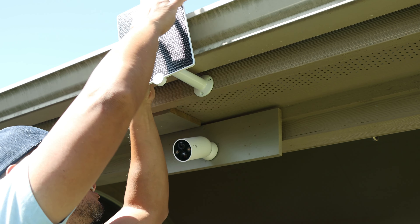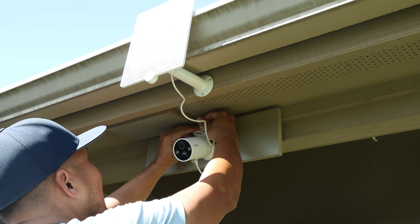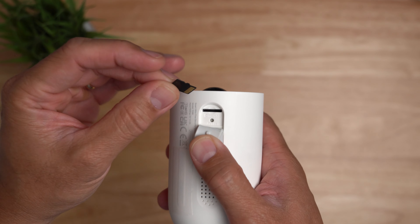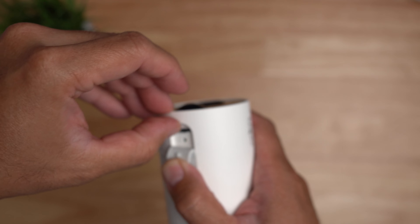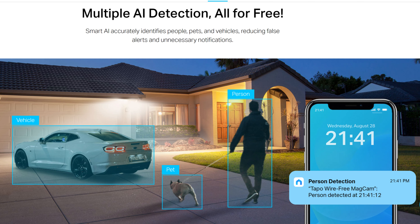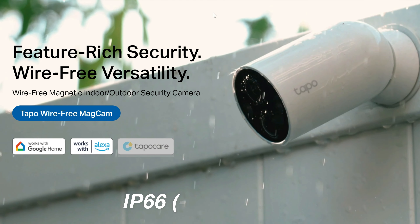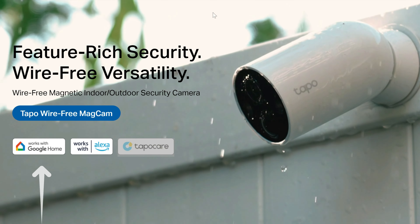You can also set this up with a Tapo solar panel to continually charge the camera's battery. Tapo states that this has a starlight sensor, but I think it's a bit too dark and will definitely need the two spotlights for color night vision. It has local storage using a micro SD card inserted on the camera itself, compatible up to a 512 gigabyte card. It has AI detection and you don't need a subscription. Cloud recording is optional, but there is one missing feature if you don't subscribe — I'll tell you about that later. This doesn't need a hub and directly connects to your Wi-Fi, 2.4 gigahertz only though. It is waterproof with an IP66 rating and compatible with Google Home and Amazon Alexa.